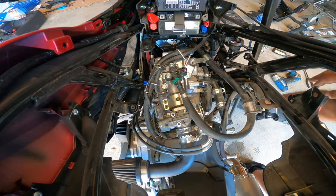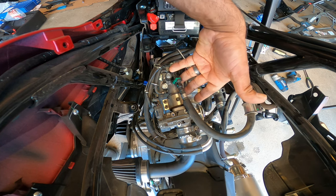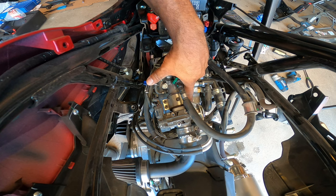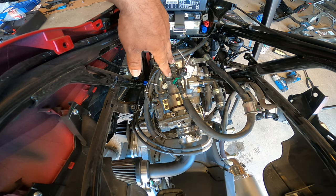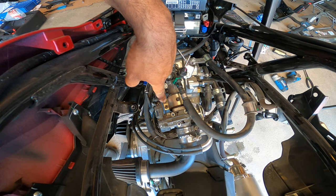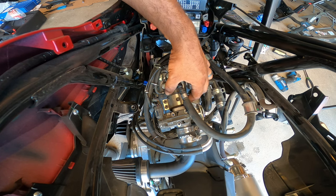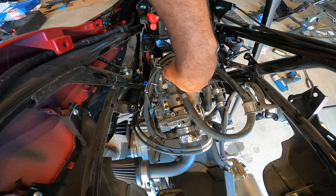That way, when you guys do it, you can walk through it with me much more accurately. All right, so we got you guys a better angle here. So now we have to pull out the intake manifold and the throttle body, because the throttle body has a tensioner right here underneath it to pretty much control the tension of the chain. So that has to come off. So easiest way to do this is take the two 10 millimeters off here for the fuel injector, pop this up and out of the way, and then the two screws right here, Phillips screws. Unclamp those, and then this should let us slide or move the throttle body over and out of the way. That way we have access to the tensioner here.